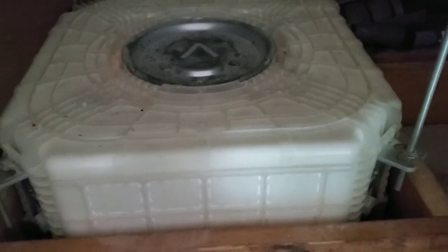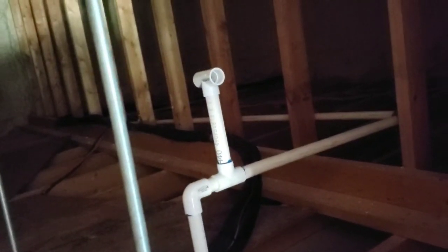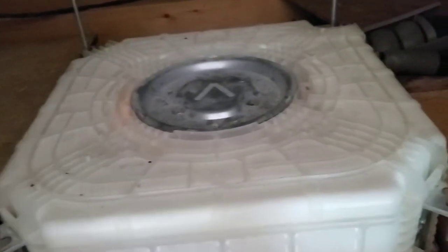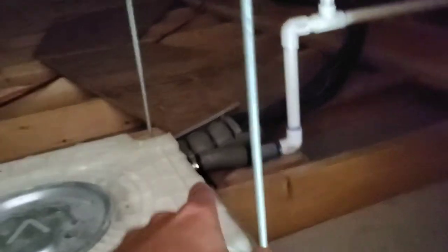This is a top view of the four-way cassette. It has four hanging brackets with all-threads running through them, then up to the unit strut I've got across the joists — that's how I hung this, really easy. You've got the drain there, and that right there is an air siphon — you've got to put that in the drain. This unit has a built-in pump that runs off 12 volts with a little float switch. It's also got a check valve after the pump, and a little hose clamp connected to a piece that comes standard with the cassette that ties into the main drain line.